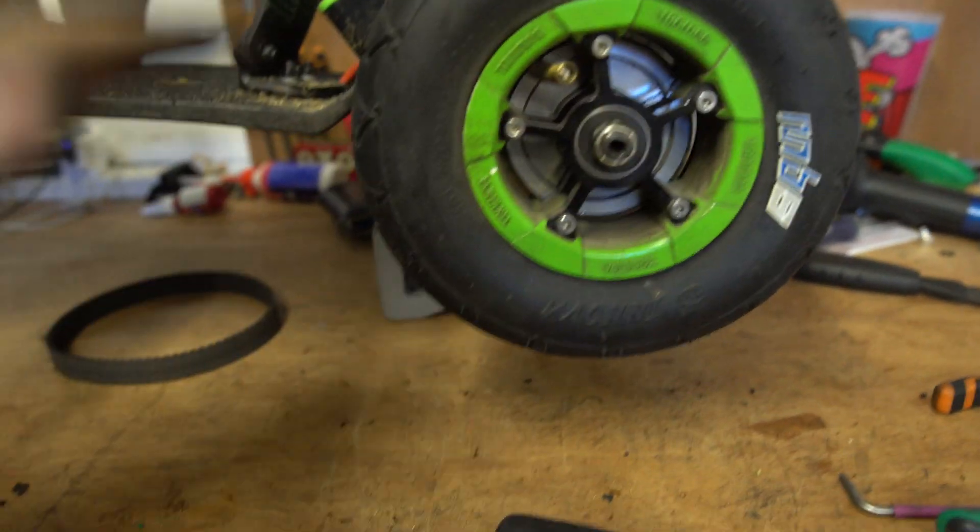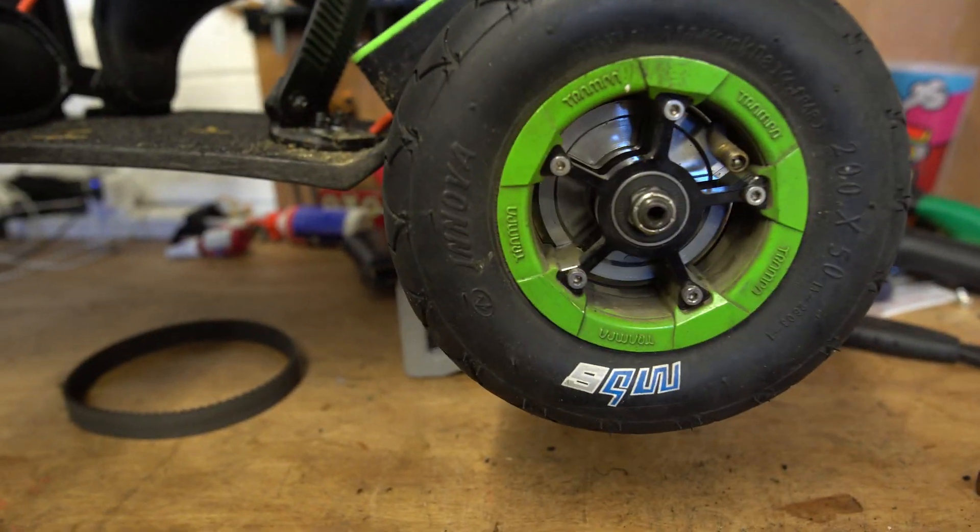All we need to do now is inflate the tire and take it for a test ride. Just took it out and it is fixed — both belts changed. Those belts were gnarly, man. Change your belts — don't leave it 3,000 miles. Yeah, that one's for the bin.